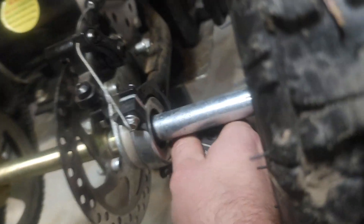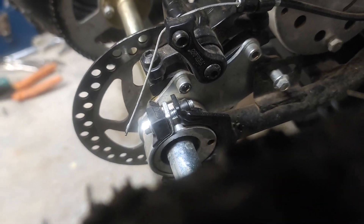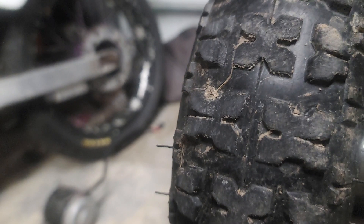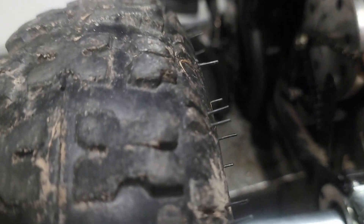You can see in the hole — it's spaced closer on this side and wider on that side. The more meat you give on the front side, the more that's going to space your axle back. The key to doing this is not having too much slack, because the motor is in here and it will move with the suspension — there's no separate linkage — so I'm going to make this chain fairly tight.